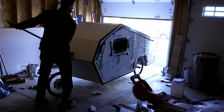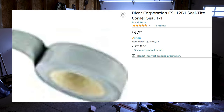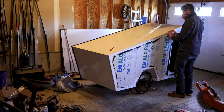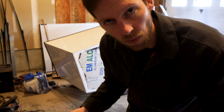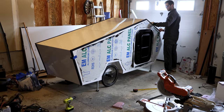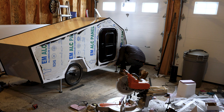Good time to turn it around and work on the other side — another full day. Underneath the trim I'm using a product from DICOR — it's got felt on one side and you just push it down; it's supposed to be really waterproof to create a seal. Today I'm going to carefully measure each angle divided by two to get my cutting angles and do all my miter cuts at once. It was not perfect — more of the same. No matter how hard I tried, the miters were off just a little bit, but I'll live with it.